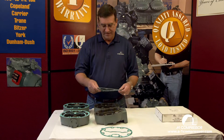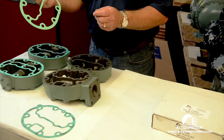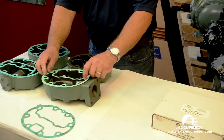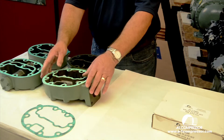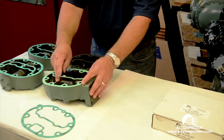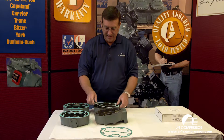This is just your plain side head gasket. If we decide we want to put the wrong gasket — say on the center head here — everything seems to line up. Oh, I've got it made, everything's lined up. But we're missing this part of the gasket. Looks just like it fits perfectly, but it's missing this part of the gasket. Common problem. This gasket only fits this head.